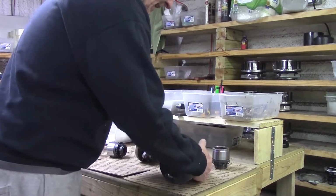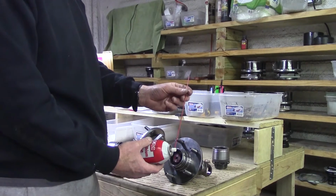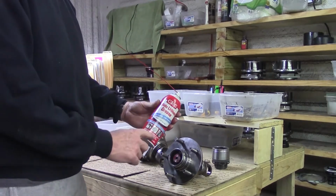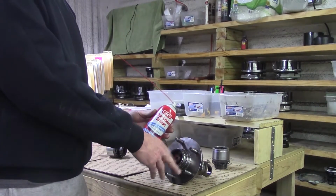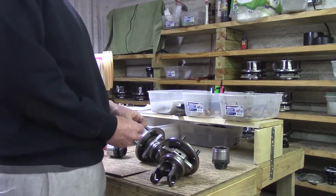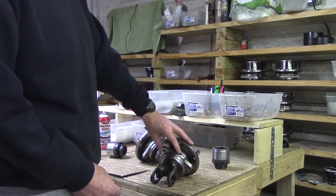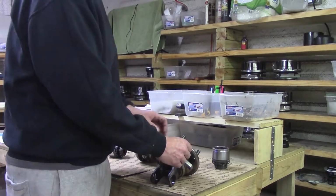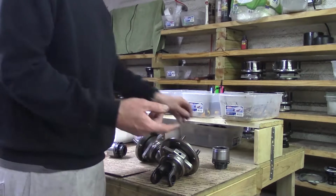You can remove it. And with our design, there's just enough clearance where you can take our red 10-inch straw, or another one, and come through here down along the side, and you can grease your bearing at will with some white lithium spray grease. So you're able to grease this anytime you feel like. You can also grease the large bearing right here through the ABS port. This is where your anti-lock braking system wire screws in, the magnetic pickup. You just disconnect it, push this little fitting in, it's got a little O-ring, and you can hook up your grease gun while it's on the vehicle.